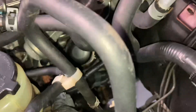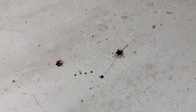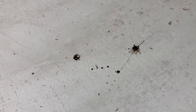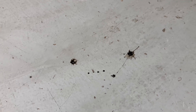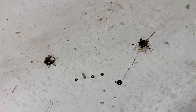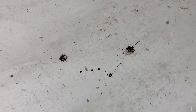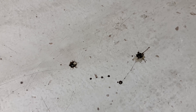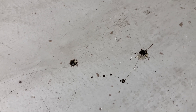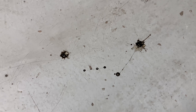Between the valve cover and the oil filter, we've solved a couple of oil leaks or weeps. Step by step, I've got to show you all the evidence so you can follow with me. This is like a court case where you've got to look at the evidence to work out what's going on. What's dripping out is a combination of oil and water. Remember, we've just washed the engine — three, four times. So there's still a bit of water there, even though I've driven about 20 Ks, it's going to take some time. Is this the old oil or new oil? Remember what I said about not using rebuilds, because this is starting to look like that.